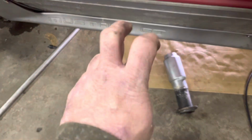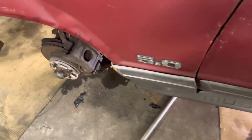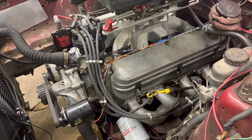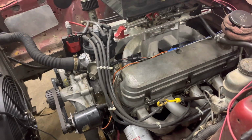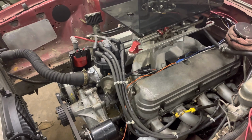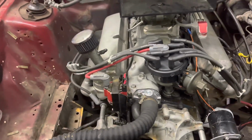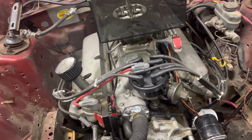We got our junk welded up. I don't have any paint here to paint them, and my frustration level is rising a little bit because of that. To be perfectly honest, I've never had any issues with any intake sealing up, except when I tried to put a non-milled intake on a set of milled heads. Didn't know the heads were milled. So I'm beginning to wonder if this intake has been milled at some point, because it's leaking on this side. Last time it was leaking on that side.